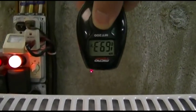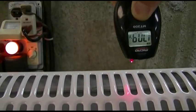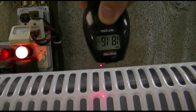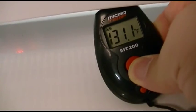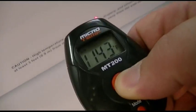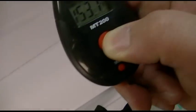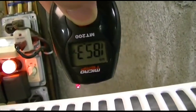I'll try the infrared thermometer and see if that reads anything reasonable — got about 173 or 174 degrees somewhere in there. It depends exactly where you're pointing it. Let's see what happens if I point it down at the bottom here. Now we're kind of reading the heating element itself. The air below is about 94 degrees, and as I go up even with the vents it's reading about 150 degrees. And if we stick it right down in there, we're over 180 now — that'll probably go above 200 degrees.